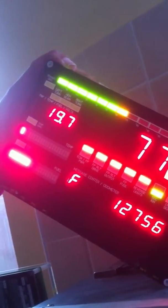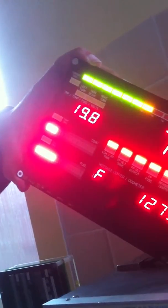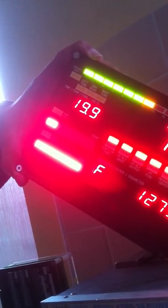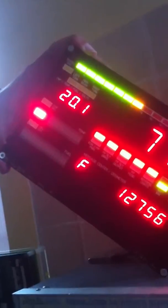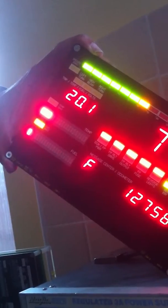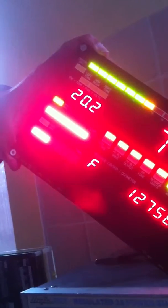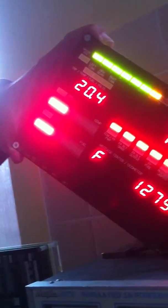These 2 bar gauges here are displays for the engine temperature, and the fuel gauge. If the fuel gets very low, the diagnostic indicator LED comes on, and if it goes even lower or short circuit, it'll flash to indicate a fault. Similarly for the temperature gauge, if the temperature gets very high, a warning LED will come on, and if it goes short circuit, it'll flash. Open circuit faults also cause these diagnostic LEDs to flash and store faults in memory.